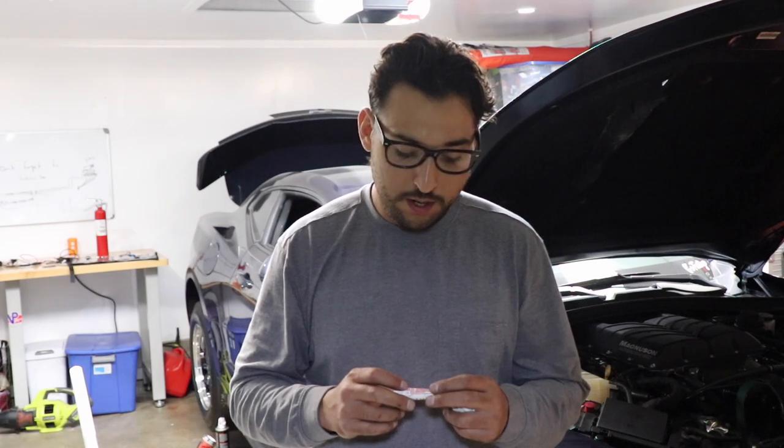Okay, guys, so as you saw in the little quick time lapse, we drilled the gas tank with a small little pilot hole. We let the gas come out. We actually pitched it forward to make sure that all the gas came out. Once the gas stopped dripping out, we went ahead and drilled it with our proper size drill bit, and we tapped it once no more fuel was coming out. Of course, like I mentioned, be very careful when you use your drill, because some of those spark. And once we did that, we grabbed the fitting with some Loctite 592, screwed it on there real nice, got about 3/4 of the way in, positioned it where we wanted it, and left it alone.